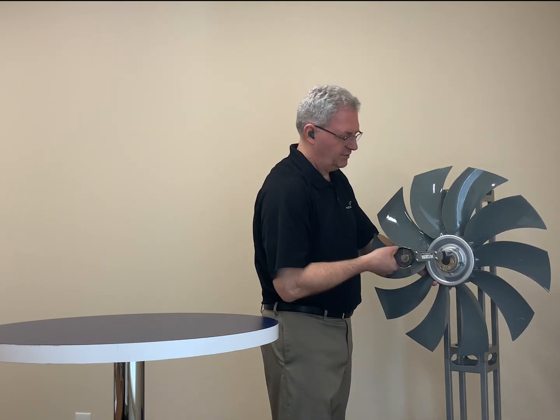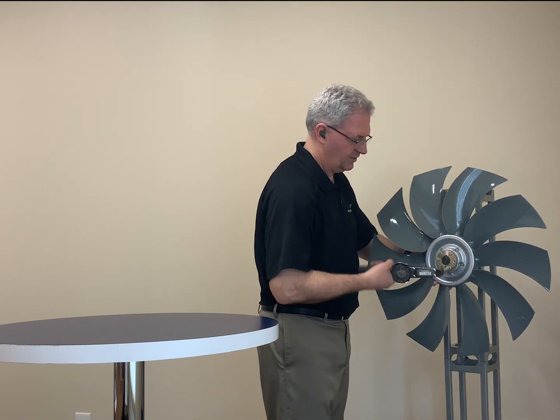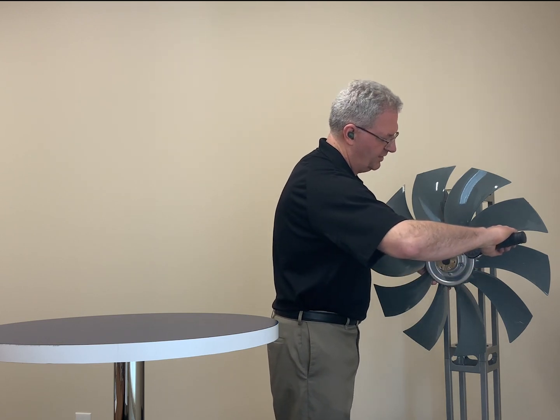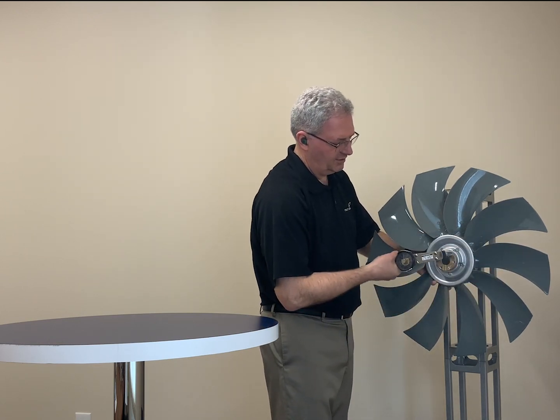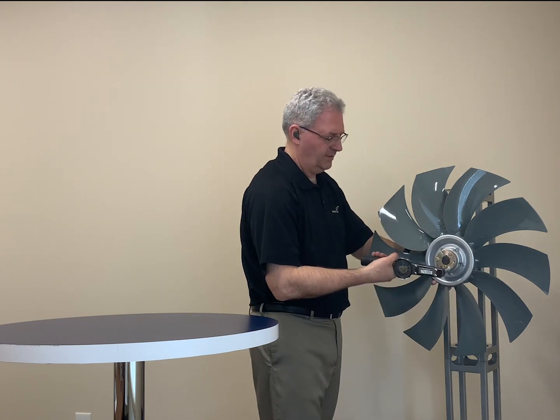It's also important that you just do a half turn at a time. You're going to take your torque wrench and walk around the boss a half turn at a time until all three bolts are set to the appropriate torque spec.